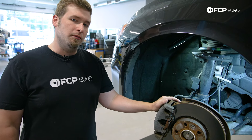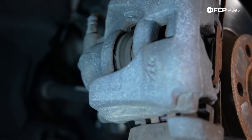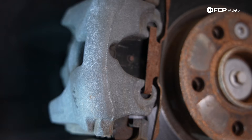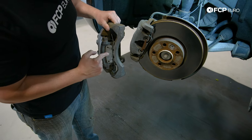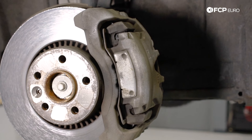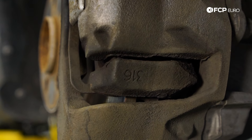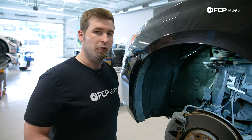The first is that this is the 300-millimeter brake setup. If you're going to be shopping for brakes, you have to know your brake size. This is a bespoke caliper, so basically the 300-millimeter brake caliper will only fit 300-millimeter brakes. See how the spring is set up? You can look on your own car and get an idea of which brake setup you have. If your brake caliper looks different, you can see an obvious difference in the spring — that would be either a 336-millimeter or a 316-millimeter brake caliper. The bracket casting will say 336 or 316. If you don't want to remove your wheel to check, you can just send us your VIN and we'll be able to tell you what size brakes you have.